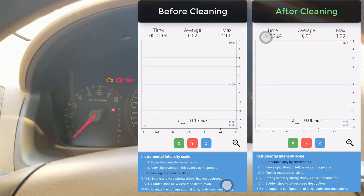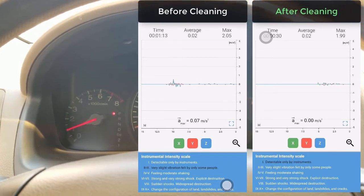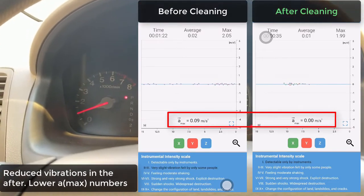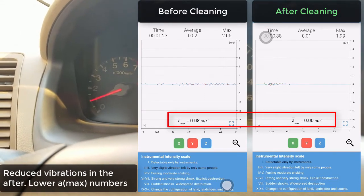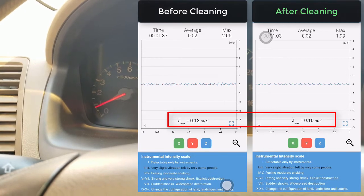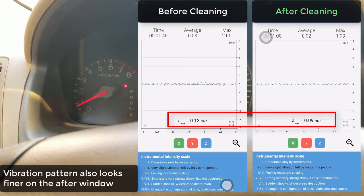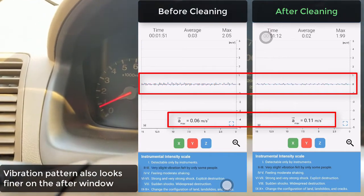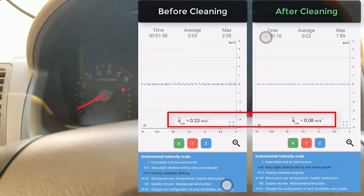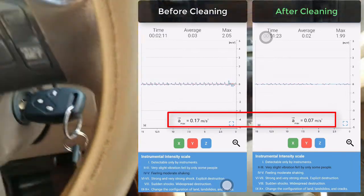Apologies if the camera shakes. As usual, I had warmed this up previously. I'm just going to wait so that the IACV valve comes down to where it usually rests. I think the values are certainly a bit lower, generally less than one. Idle has settled — that's looking where it usually is. So we're going to proceed to start adding loads to the vehicle. First of all, steering wheel is straight and every accessory is off.